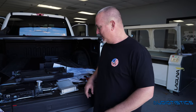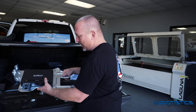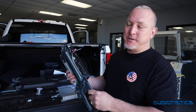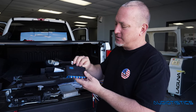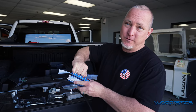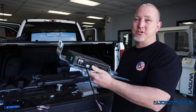Today we're working on this 2022 F-250 with a B&O system. What's cool about this system is it's simple yet high-tech and sophisticated. This is the factory B&O amplifier that we pulled out — it was mounted to this bracket — but we put this Audison Forza five-channel on there, which is going to power our factory speakers. We're using this PACK interface piece to get sound out of the factory radio. What's cool about this one is it has an optical output for a TOSLINK cable, which is going to go directly into our Forza amplifier, so it remains digital the whole time.